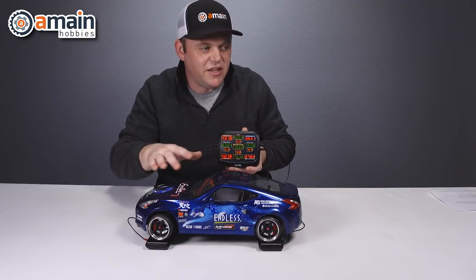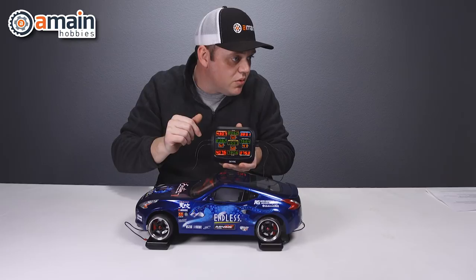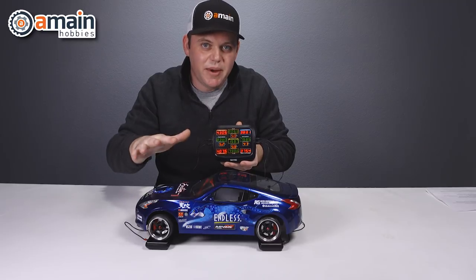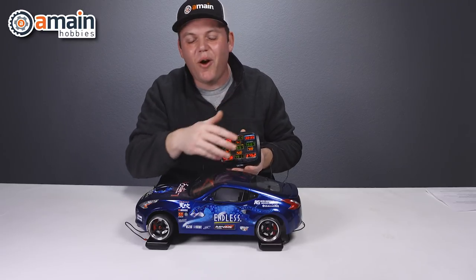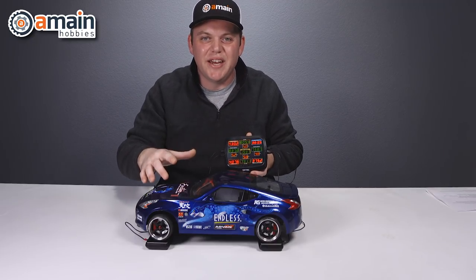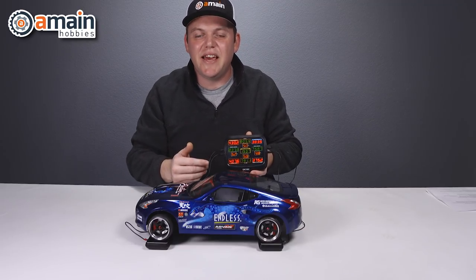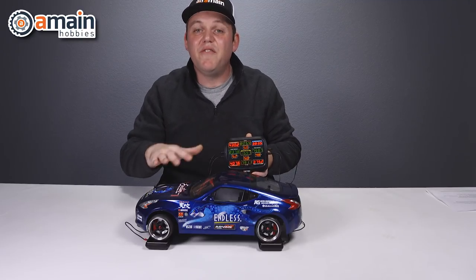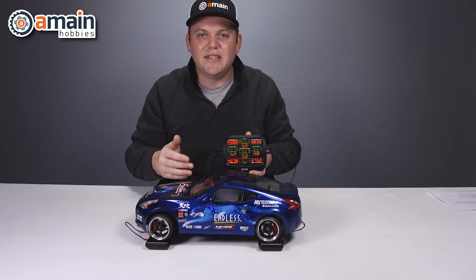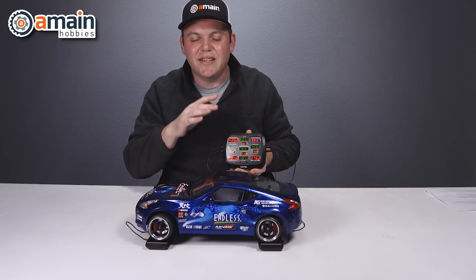There's quite a bit of front-to-rear bias there. The left to right looks like it's actually 50-50 — the grams are a little off but as a percentage it's about 50-50. You can see that with all this information it's really handy in knowing how your car is set up and then altering it if you need to make changes. Oval guys would want their left to right weight bias differently than a 1/10 scale touring car where you want the vehicle very balanced. For a rock crawler, it's good to know your front to rear weight bias and whether you should correct it. There are a lot of uses for the corner weight scale system.